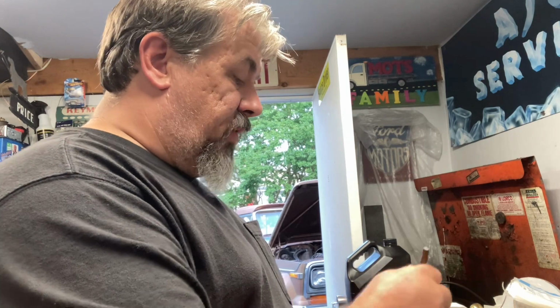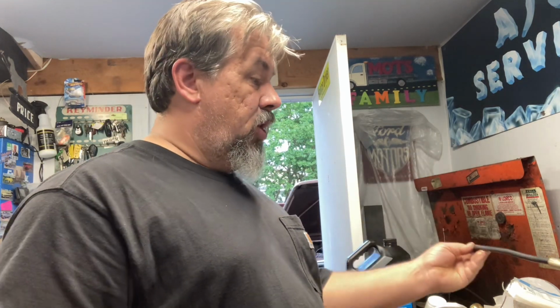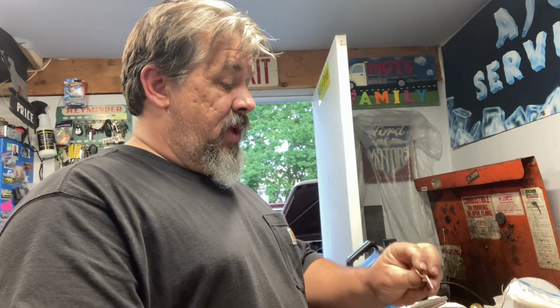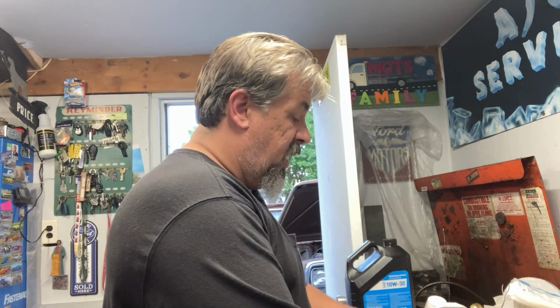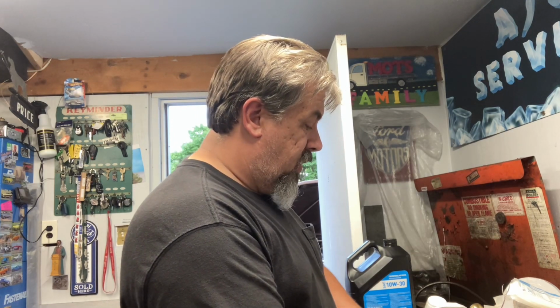And I already know somebody's going to say, "Oh, if you solder them on, if the terminal gets hot, it could melt the solder out." Let me tell you something. If you have a problem that's drawing that much amperage to melt the solder out of there, you've got other issues. You've got bad ground, you've got starter, you've got something else going on. I have been making battery cables this way for equipment and all kinds of stuff for years. I've never had an issue. I've never had a cable melt, fall apart. I've always had good luck.